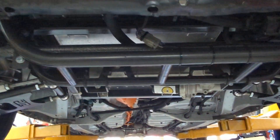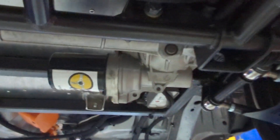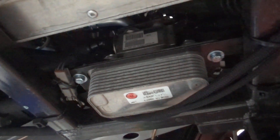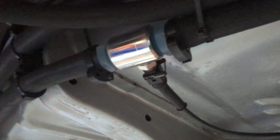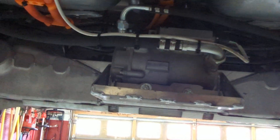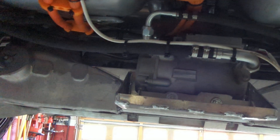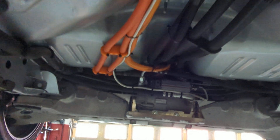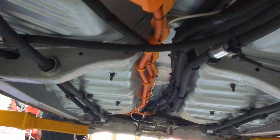I did a pretty good overview of the whole install but there's a lot of little things like this electric rack and pinion. I've got lots of cooling components like this AC flat plate heat exchanger that uses the air conditioner to chill the battery loop. I've got temp sensors, a 400 volt AC compressor, the battery management system, electric calipers, and the T2C controller. Let me know what you want more detail on and I'll go into the finer points of each of these components.